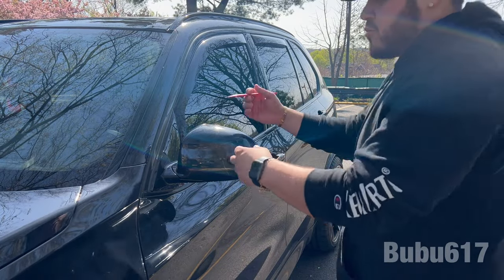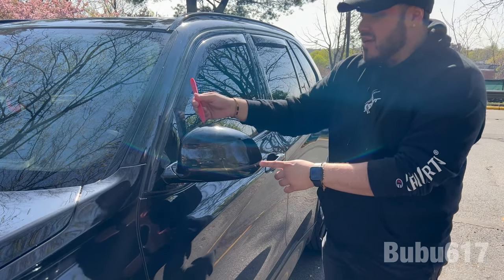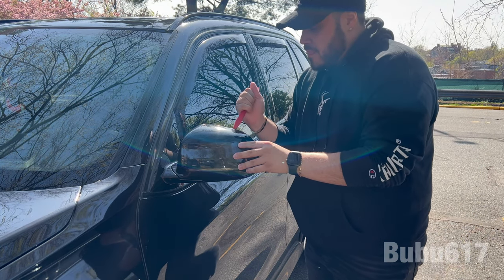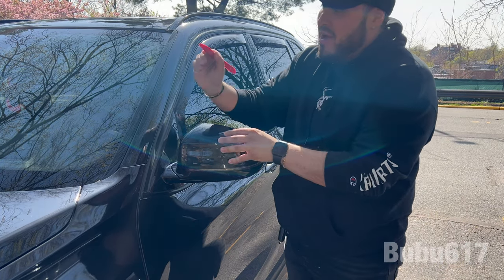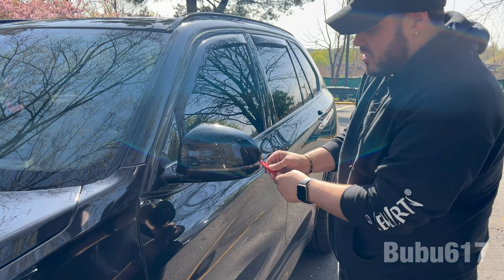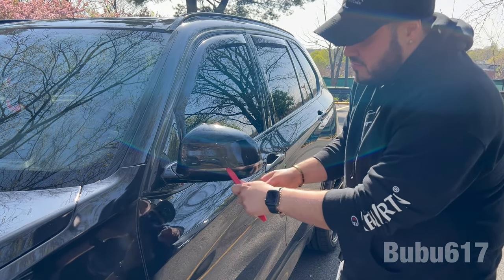Now I'm going to do this side in third person so you can see from a different angle. I'm going to get my trim tool and put it in. I started from this corner — I don't think it matters where you start. I 100% recommend buying a kit like this for trim work because it's plastic and not going to damage anything. Theoretically you could use a flathead, but that's metal on plastic and you'll scratch up your paint. These trim toolkits are pretty smooth.